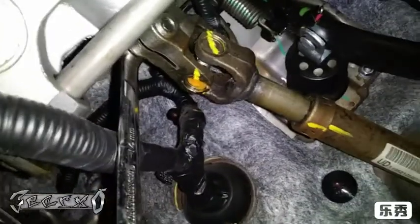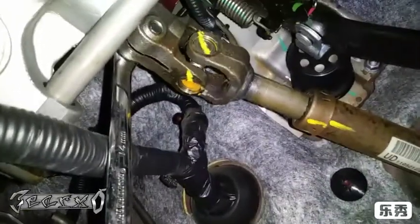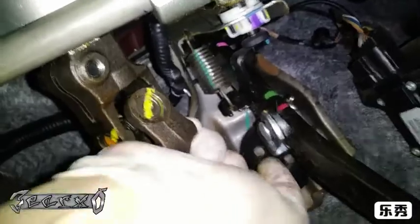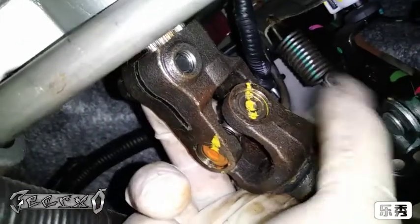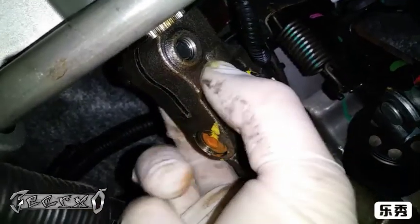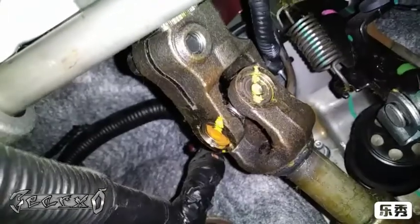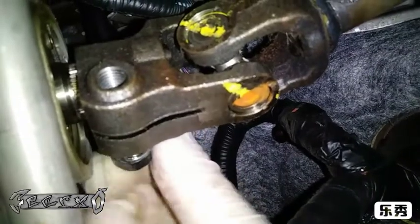The top one is actually a 14 millimeter bolt, right there. I'm going to go ahead and get that out — it's a little tight. I got it loose, and it seems like just getting it loose is enough to let it move a little bit down the shaft. But you'll probably want to take the whole bolt out because the shaft balloons at the end. Take the whole bolt out and it should come off. I got it loose enough to just unscrew it.